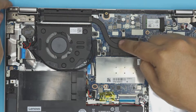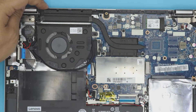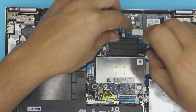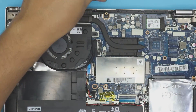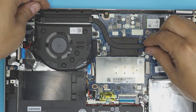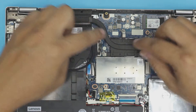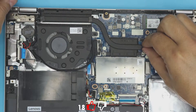Next, you want to remove the heat sink. There are only three screws holding it — they're all the same size, so don't worry about it. Once you remove the screws, grab the heat sink from the back — don't grab it from the tiny tail end. If the thermal paste is really glued in, grabbing it from the wrong spot could bend the pipe, so grab it from the correct side and lift it up.